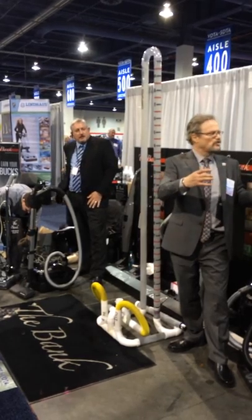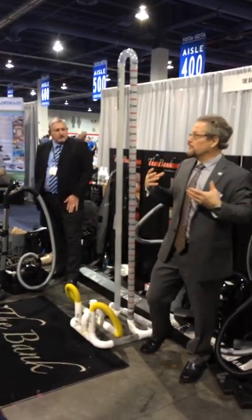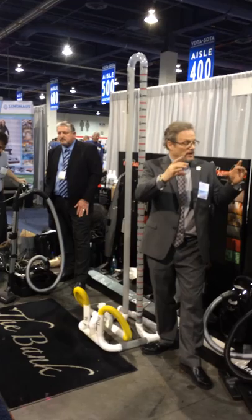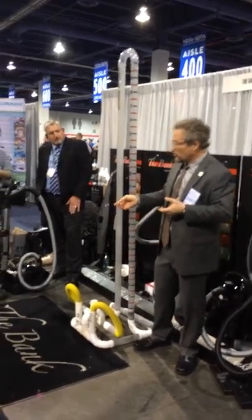When we look at the brush roll design — is it metal? Is it plastic? Do you have pet hair? Do you have long hair? All those things are going to get through that power nozzle, through that motor, through the brush roll, and they can affect how long the vacuum is going to last. The critical question is whether it's a metal brush roll, a plastic brush roll, and how it handles pet hair and dirt.